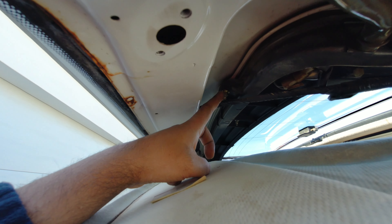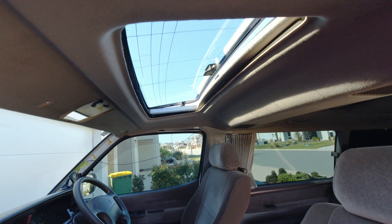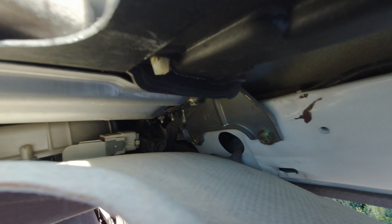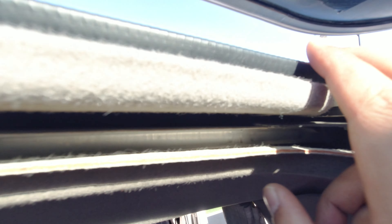What was wrong was that I went around all of these 10 millimeter nuts — connected to bolts with a spanner and a 10 millimeter socket drive. The one that was loose and creating that racket was the last one I did, and the most annoying to get to. I was basically crouching on the passenger seat, prying this down a little bit. You can see those 10 millimeter nuts and bolts back there — that's the one that clamps this panel down.